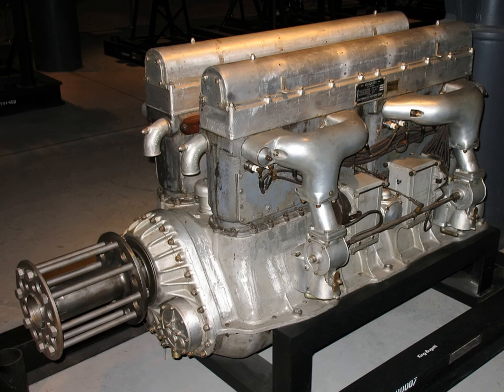A square four is a type of four-cylinder engine, a U engine with two cylinders on each side. This configuration was used on the Ariel square four motorcycle from 1931 to 1959. Although the engine was compact and had as narrow a frontal area as a 500 cc parallel twin, the rear pair of cylinders on this air-cooled engine were prone to overheating. This design was revived as a liquid-cooled two-stroke version on some racing Suzukis, and their subsequent road-going version, the Suzuki RG500.